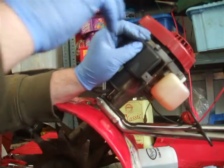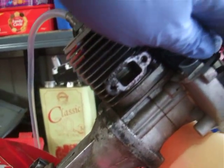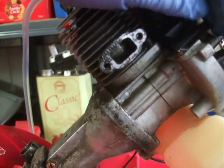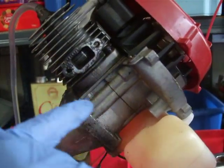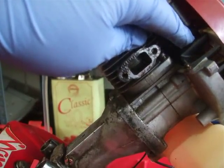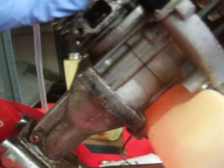I'll take the exhaust off and have a look in there. Let me see the piston — see the rings. A lot of the rings are stuck right in there — it's just smooth. I think you're getting a bit of — I think it's just losing a bit of compression, just worn out. Even though it looks like it hasn't done much, I think it's got hot.